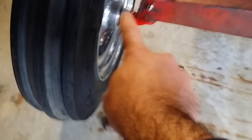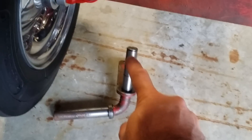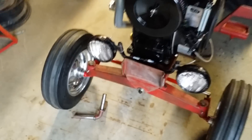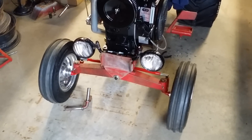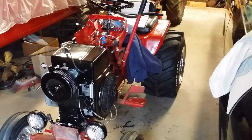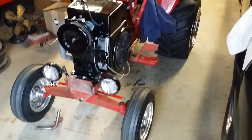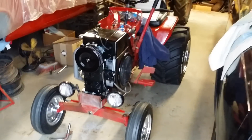I lowered it down and re-welded it on. Then I measured the distance, lopped the top of it off to shorten it down, and re-welded this section of the spindle so I could still use the original e-clip. When you look at the tractor in general it's only a one-inch rake, so it's not super aggressive. I think you could almost pass it off as original and most people wouldn't even know the spindles had been messed with. Once I get it out into the driveway you can actually see the rake, which is kind of cool, because with the 24-inch tires — those are theoretically two inches taller than the original tires — and the one-inch drop in the front, there is about a two-inch rake between front and back, so it really does have a little more of that aggressive look.